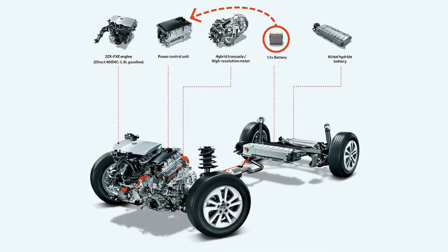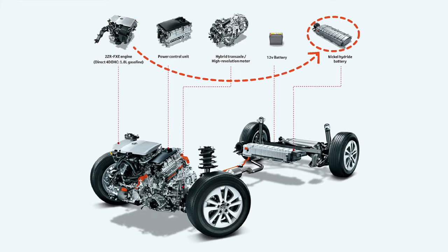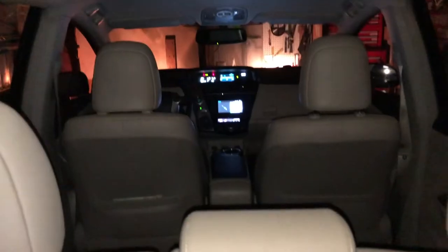There's a high-voltage battery called a traction battery, which is kind of invisible — it's under the back seat of the car. It's the thing that actually provides the motive force for the two wheel motors. There is also an internal combustion engine which recharges the traction battery.